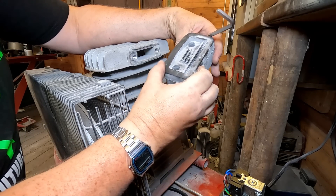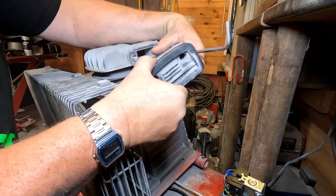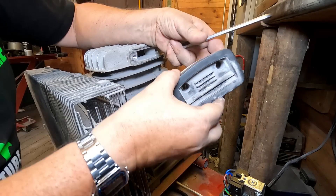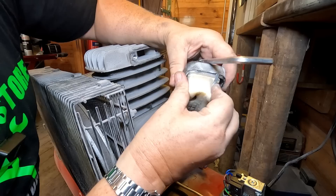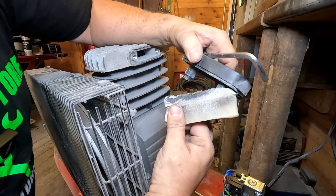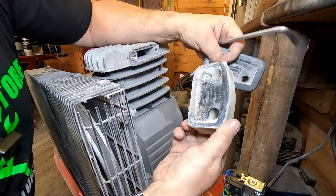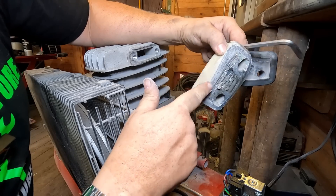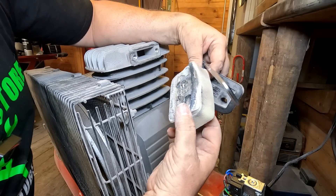Look at all the dust that's collected around this. If you don't have a clean air filter, or no air filter, it sucks in dirty dusty air, and that'll ruin the seals on your piston. Let's have a look — the air filter has been doing its job — look at the state of that. It's well overdue a good clean or even a change. Look at that — wow, look at the crap on there. That compressor has hardly been breathing at all! It's rock hard with dust. I'm going to order a new one anyway, but for now I'll cut a slice off and give it a clean.